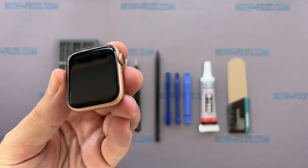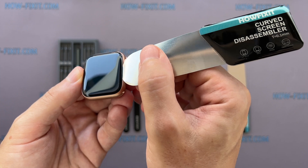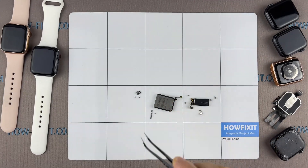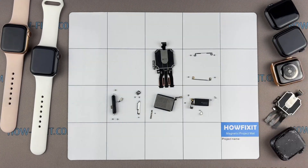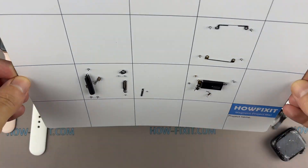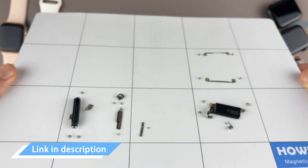This screen disassembly tool is a must-have for disassembling all Apple Watch series, because the gap between the screen and the watch body is so thin. I recommend using a magnetic mat during the repair process, which is especially useful in the case of the Apple Watch. Throughout this disassembly, keep track of each screw and part so you can put them back in the right places — this will help you successfully reassemble your watch, and you won't lose any screws on the magnetic mat. I left links to buy all the necessary tools in the description.